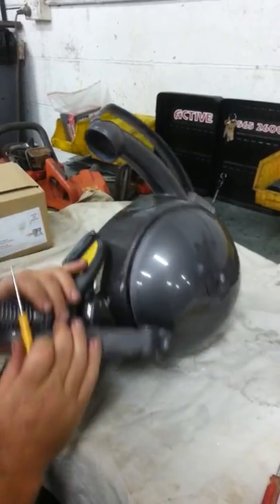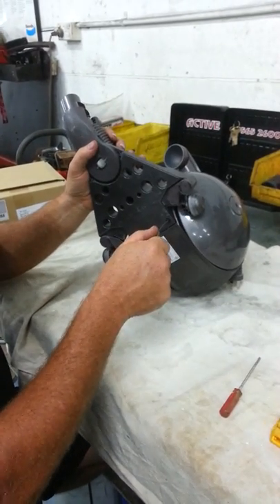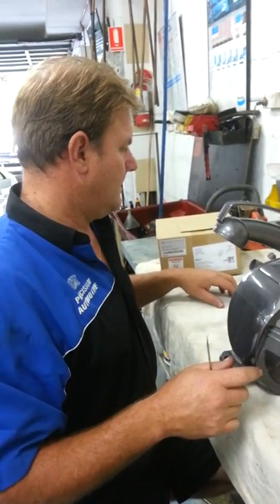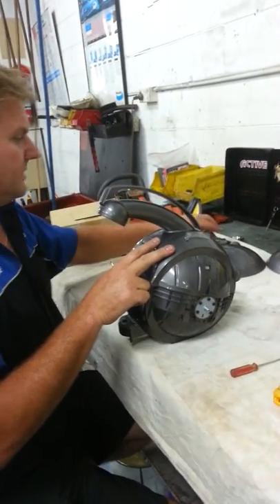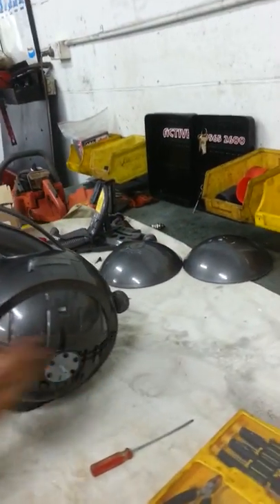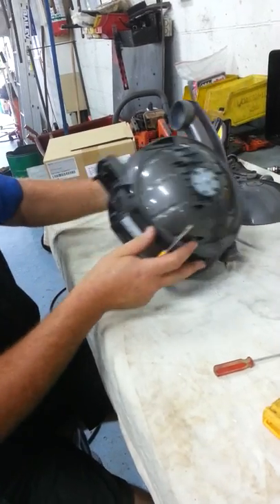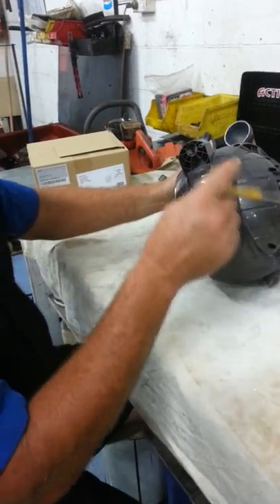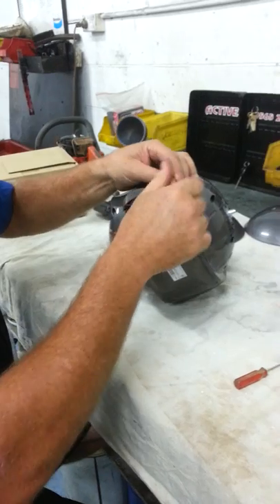You've got your base plate here - this base will come off, these two wheels will come off, and I'll show you the internal parts. We've got the wheels off - four screws for the guide wheels, and there's two on the side for the other sliding wheels. So you've got your drum here, and there are eight screws that hold this base together. I'll rip them out and then show you the rest on the top.